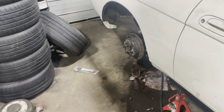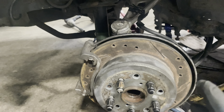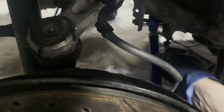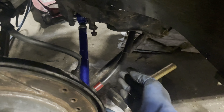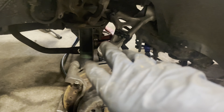I know I've been all over the place. New rear end is in — don't mind this, it's just water that leaked in. I'm assembling everything back here. I had to get new toe arms because the other toe arm was bent and I couldn't get the other one out without bending it. Got my ABS all set up so it's out of the way. I got to put these bolts in to hold this e-brake cable back up. But rear trailing arm, toe arm, top control arm, lower control arm are all attached. Suspension is attached, sway bar links are attached. All this is nice and stiff. Now let's go to the bent side.